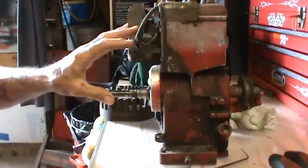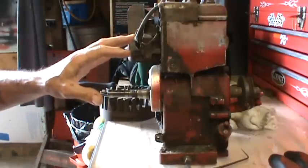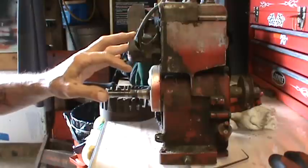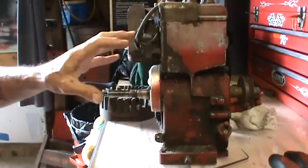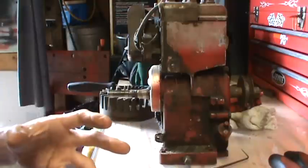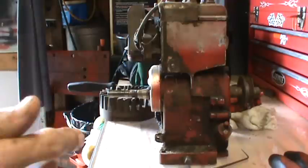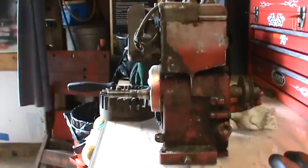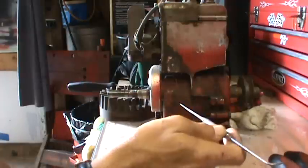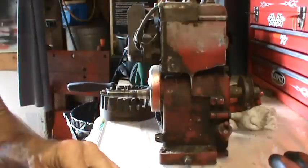Engines like this that you buy in their natural state with the oil and residue on them, most generally shows it's an engine that's been at least maintained, and you have a better chance of getting a good running engine than you do with an engine that is spotless, not even necessarily new paint, but just spotless. And I always check the oil in them too. I check the condition of the oil, and I always have a little pair of pliers that I take, and I push it down in there, and I get down into the oil pan. And then getting down into the oil pan, I'll pull it back out, and I'll see how much sludge I've got on the end of the pair of pliers. I'll show you the pliers here.